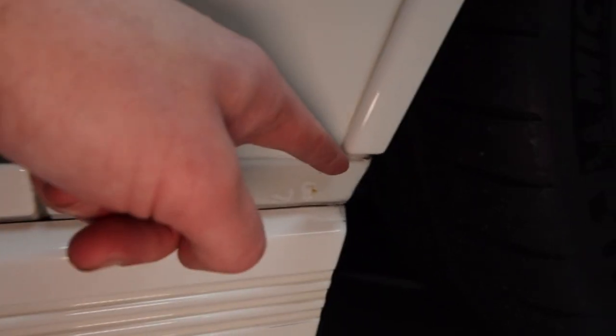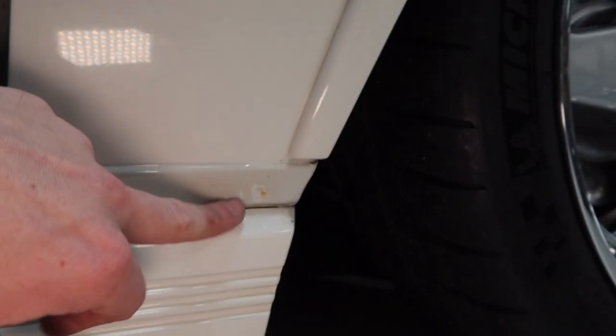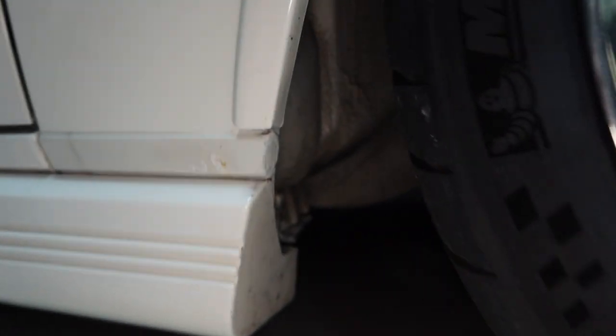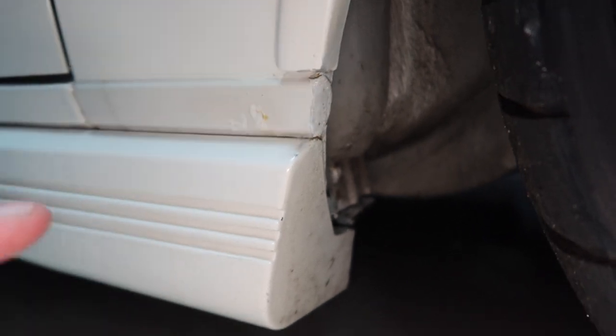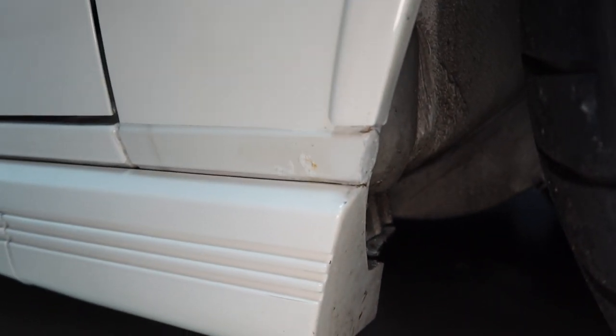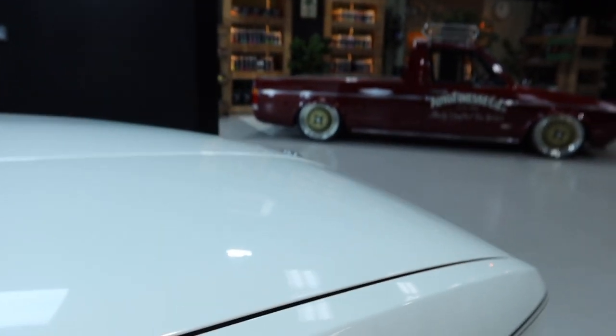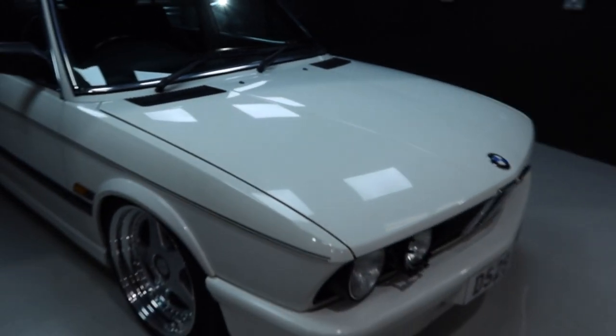It's not good - it's sort of an old smart repair of sorts. You can see the tape line there. We've got some surface rust coming through that someone's crudely touched up. It does run a little bit just into the edge of the arch here. Like I say, that is the worst part of this car - it doesn't really get any worse than that. I think we can keep that localised down here. We'll get a specialist in to fix that for us, probably blend it up here somewhere or maybe even paint this whole area in. I'll be led by them on what they recommend. But looking around the rest of the car it's in good order.